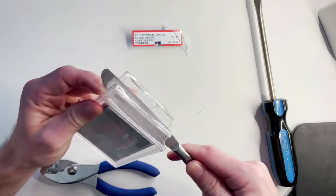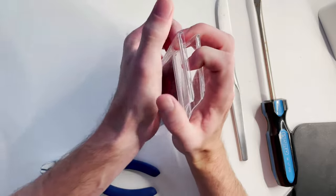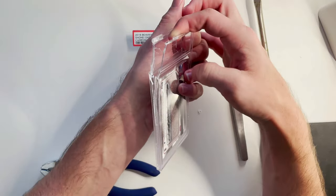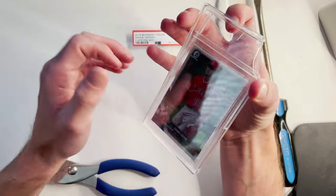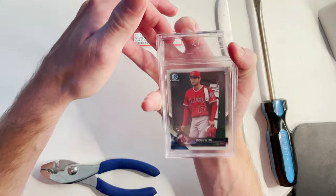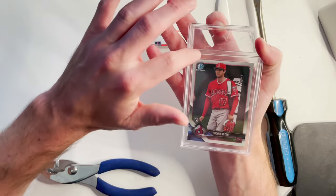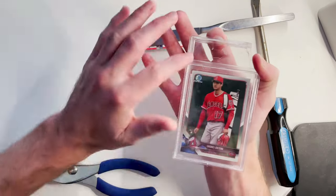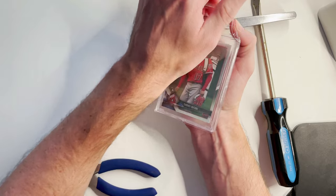You can see now I have this thing pried open. What I'm going to do is slide my finger in between — that way I keep it open. And now I might actually be able to get this with my hand slowly. What you don't want to happen is you don't want to pull back very hard and rip this case in half and have the case basically right here with the card hanging out — that will make it very, very difficult to get this card out. Do not pull this and break this piece off, because this is what you want to have to apply leverage to remove the card. Do not just rip this off and then have this card with a hole in it and no broken seals here, because it's going to make it very difficult to unbreak these seals without damaging the card. This is a very, very critical step — you want to go very slow.